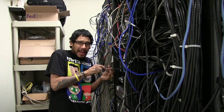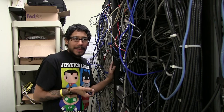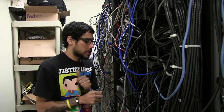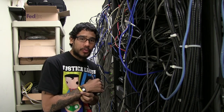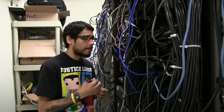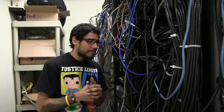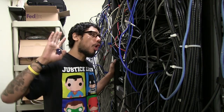Then I believe on Monday I'm gonna power it up, install the operating system on the first bay, I believe bay 0, which is the terabyte hard drive, and insert the additional hard drives in it, go inside the RAID BIOS setting, I think it's the RAID software, and then configure it, initialize all the disks, configure it to a RAID 5, and once I do that, the operating system should be up and running. I gotta push out all the updates.